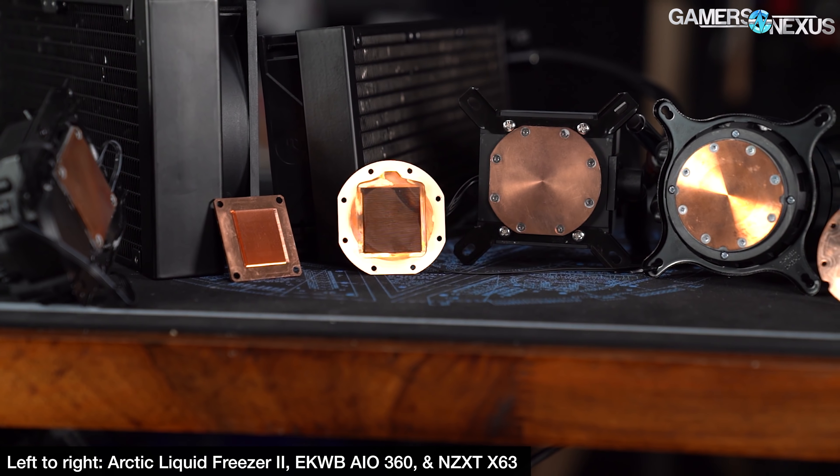Note, however, that we don't have the Liquid Freezer 2 360 to test right now, so there'd be some competition size for size. The EK cooler is now the chart topper, and holds a tactical victory over the rest of what we've tested on this AMD platform. The EK AIO 240 runs at about 54 degrees over ambient, ranking it functionally equivalent to the Kraken X62 280 CLC with the older Asetek Gen 5 pump, while the EVGA CLC 360 and Kraken X72 show poor static pressure performance at the restrictive noise levels set — they just can't overcome the resistance with the noise-constrained RPM. The EK AIO 240 at $120 is worse value than the Arctic Liquid Freezer 2 280 at $95, although its compatibility with size may be something to consider.